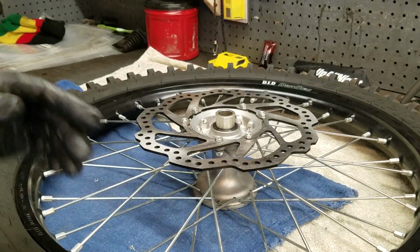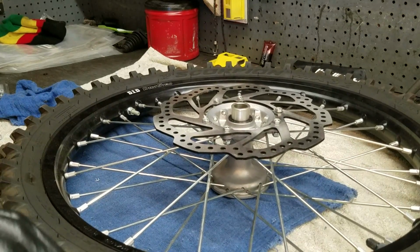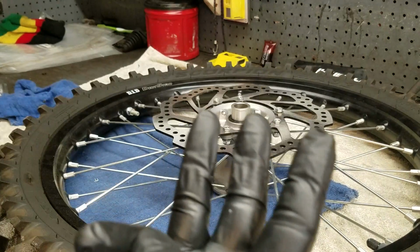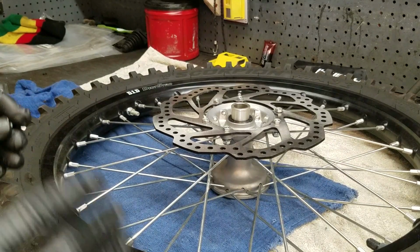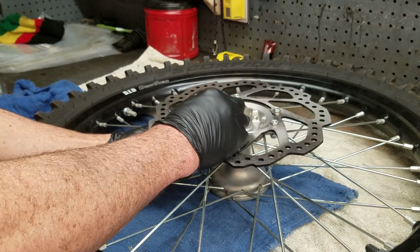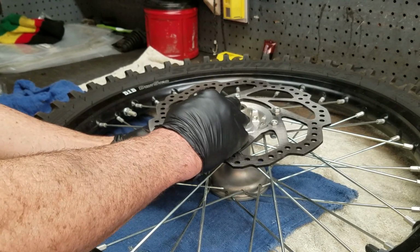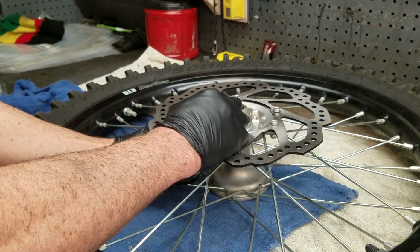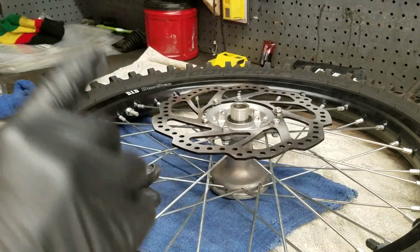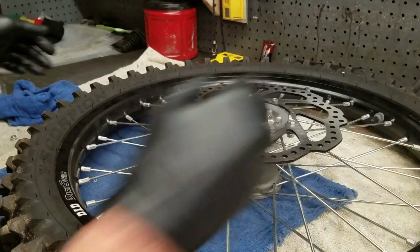Let everything break in. But now let's move to the full motor rebuild, both top and bottom end. On that one, it's going to be the same steps with the 3 heat cycles on this stand. Same thing. Full heat cycle until it's about 180 degrees. Shut it off. Give it 15 minutes to cool down. Checking for leaks. But at that point, you'll be checking not only for coolant leaks, but also oil leaks, because you did a bottom end too, right? So you had the whole cases split. So you're going to want to be checking everywhere, the whole motor, underneath it, every corner of the motor, and just make sure nothing